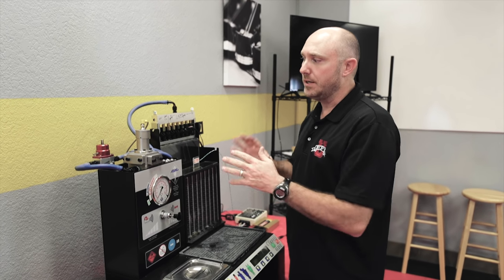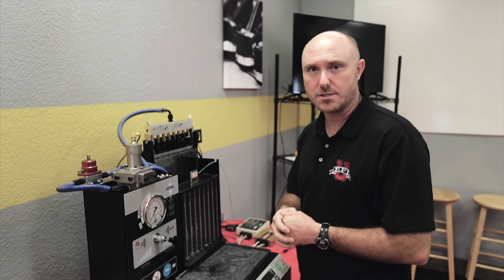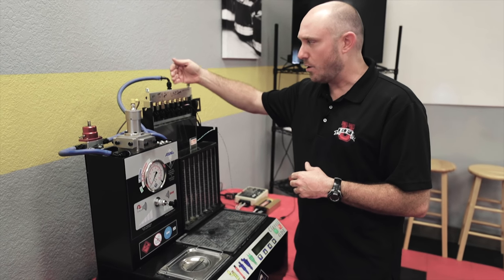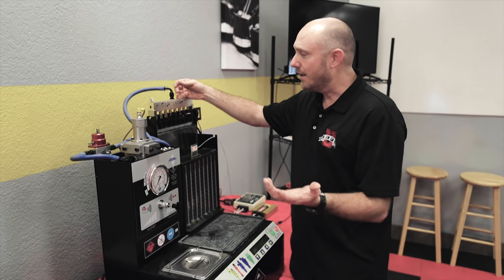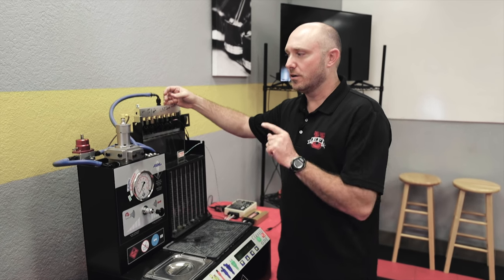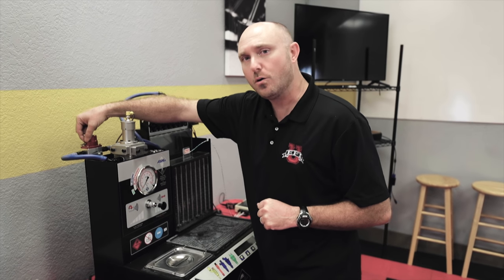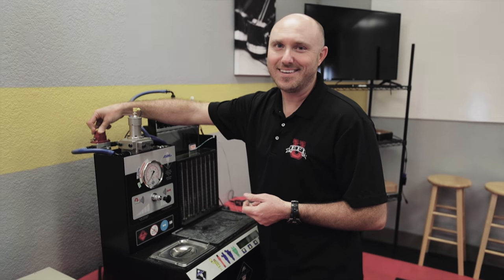The reality is manifold pressure is changing all the time as you drive, because every time you move the throttle or change the RPM, manifold pressure changes. Since the tip of the injector is inside the intake manifold, the last thing you want is constant fuel pressure on top of the injector — if you had that, the injector would always flow something different. So when installing your fuel pressure regulator, make sure you connect the hose to the intake manifold so you don't sound like an idiot.